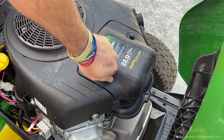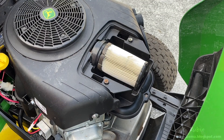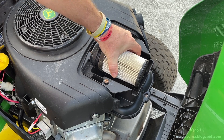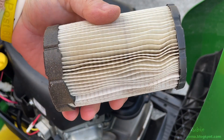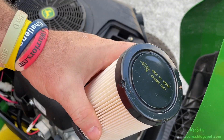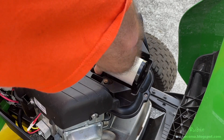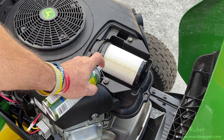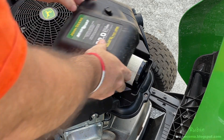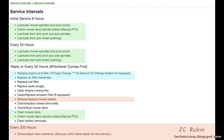Now the air filter — nothing nonsensical here, thankfully. Unscrewing the two screws we remove the cover of the air filter housing, carefully pulling it up on an angle and detaching it. I would generally blow this out with air; it's not that bad, but for the video I'm going to replace it with a new filter since we have one. The new one is identical but cleaner — pop it in from the back first then push it down. The front of the housing holds the filter in place. One screw is a bit rusty so I spray it with oil before putting the cover back on. Placing the cover on and hand-tightening the screws concludes the air filter replacement.